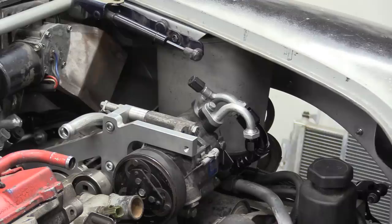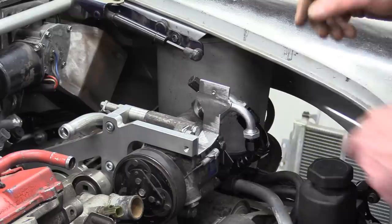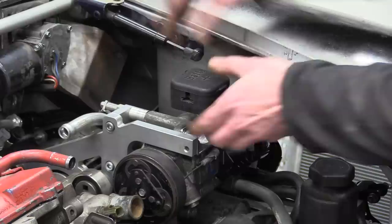Still, he's in his happy place right now, making a bracket. And quite a handsome bracket it is too. 3mm steel used for this one for some extra rigidity, as the jump post box is sitting right on top and we don't want the bracket fracturing through vibration. The M8 fasteners might seem excessive, but that's what's already on the car that we're fixing to.